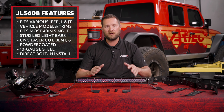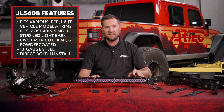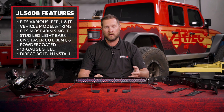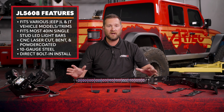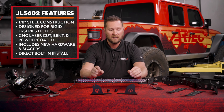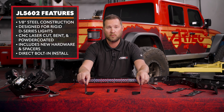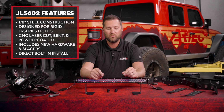These brackets for the hood mounts, they're all made out of 1/8-inch steel. It's still laser cut, CNC bent, and uses our 6-stage powder coating process. If you don't have a 40-inch light bar and want to run one slightly bigger, we have them for the 50-inch as well. You can kind of see how it has the slot and the stud mount here. So it's just any universal light bar will work with this, or high-end brand if you want.